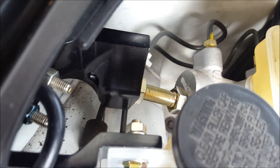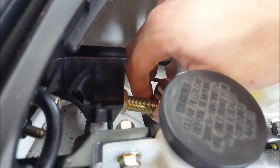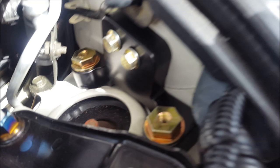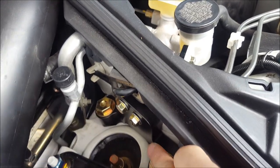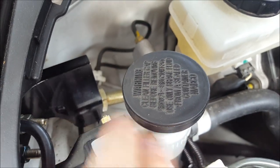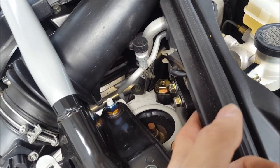Here we are in my car. What you actually do is put in a bracket — this is all CNC machined — there's a bracket here with a bolt and a jam nut and it loads right up against the booster. When you're installing it, you tighten it all the way so you're already pushing up against it and that way this thing can't move at all. The bracket loads up onto the factory strut using special fasteners — you take out the factory ones and put this onto it. This holds the factory dampener and then the whole brace transfers load into another bracket which holds the reservoir for the clutch, then attaches to the firewall and bolts to the other bracket, loading the force right into this piece because this is a critical point of your suspension and all this area is incredibly strong. This wall is not that strong, so that's why they had to load it into here.